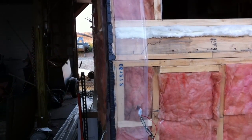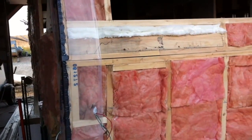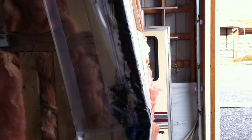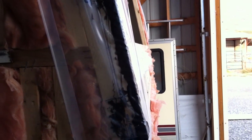This is just a quick update showing how you can protect the corners of your trailer during a repair job. The problem with the corners is that two pieces of siding come together and are held onto the trailer with a large quantity of staples that go through the siding and into the wood. The corners are sealed by a corner trim and the application of sealing tape such as butyl, and the corners are probably the most vulnerable location of trailers.